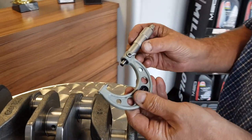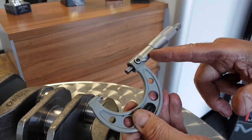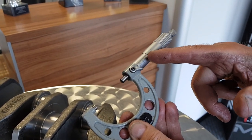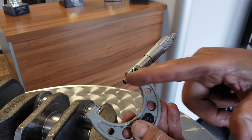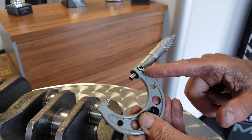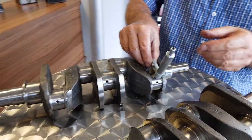So that is where we should be. So 1 inch, 700 thou — going along 1, 2, 3, 4, 5, 6, 7 — and 25 plus 25 is 50. So 1 inch, 750. Just lock the barrel. Now that is the size of the big end.